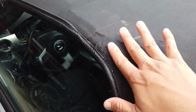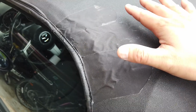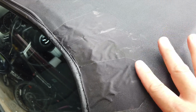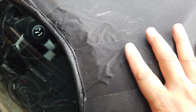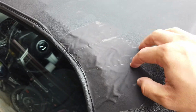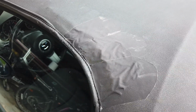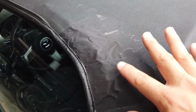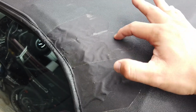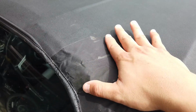Now, it looks like that adhesive did a pretty fair job of keeping the tape down, but what I should have done clearly is painted all the way to the margins of the tape, and maybe even painted the backside of the tape. So what I may eventually end up doing is purchasing another one of these kits if I want to try it properly, removing all of this and then painting the back side of this tape with their adhesive to make sure that all the corners are sealed, then placing the tape down over the defect, and I still maybe paint some of that adhesive into the defect, but you definitely need their adhesive or some kind of adhesive to hold down these corners and edges, because otherwise it for sure starts to peel up and curl.